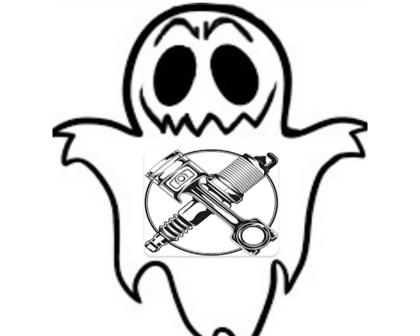Sorry about that, team. Looks like I ended up deleting that part of the video, obviously not purposely, but after you get the O2 sensors on, torque them to spec, you're pretty much done at that point. Just clean up, start the vehicle, make sure there's no exhaust leaks, spray it with some soapy water. Look for any bubbles. If there is, go ahead and tighten those areas down.